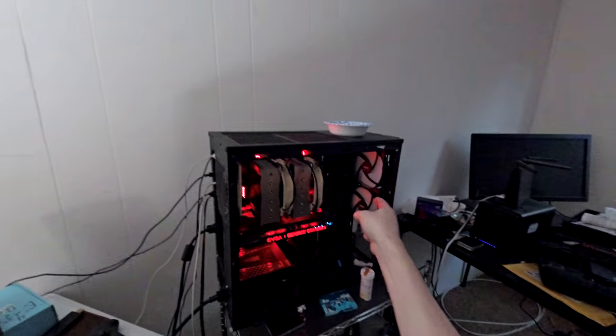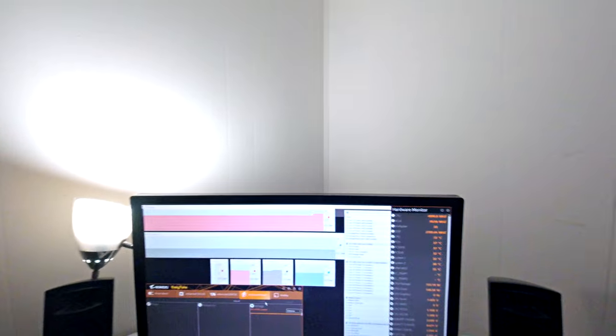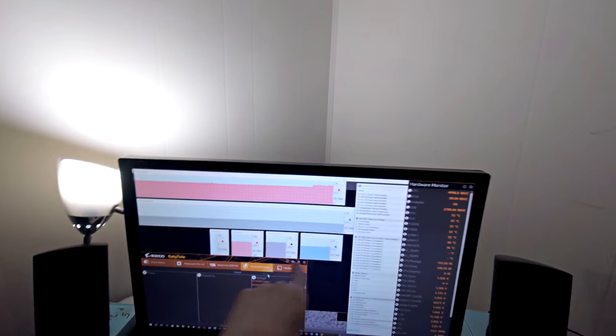See, this is something weird that I noticed: those fans were manually set at 100%. So how come when things get really hot, there's an extra 5-10% that the motherboard gives the fan? Where'd it come from? They were already going as fast as they could go. I don't get it. Don't know what that is. But look how much hotter that is. 82, 83, 84. The VRMs are starting to pick up.